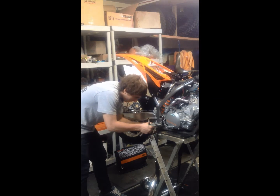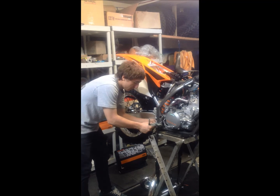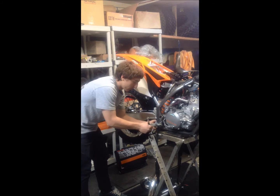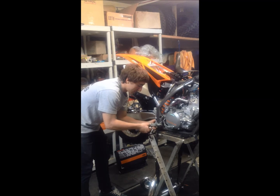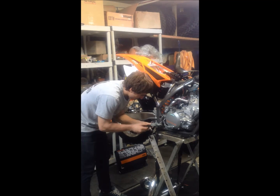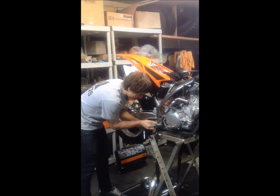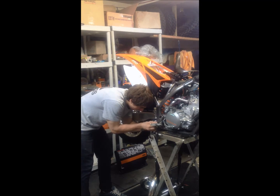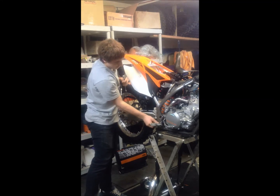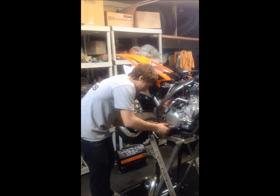In the assembly process of the bike, they put Loctite on the nuts to make sure it holds the bolts together properly so nothing falls apart while riding due to the vibrations of the bike itself. Now, this bolt will be easy to take out. Once it's loose enough, you can take it out by hand. Wiggle the paddle a little to help you.